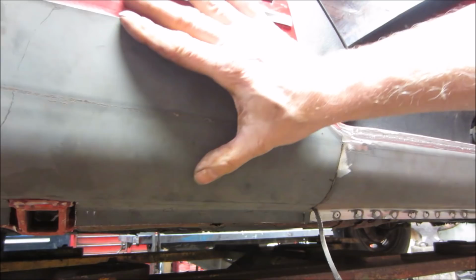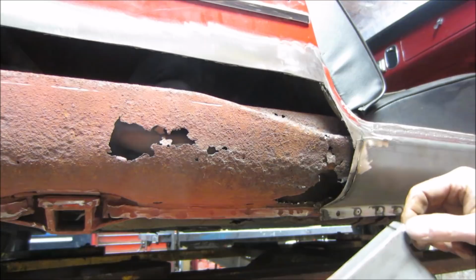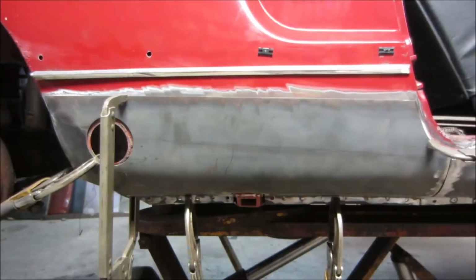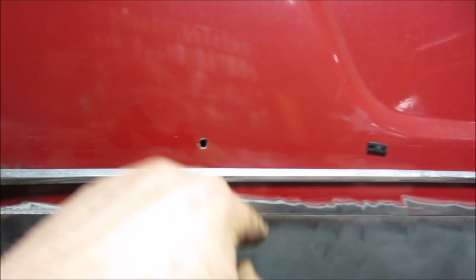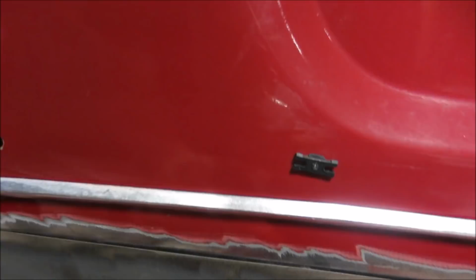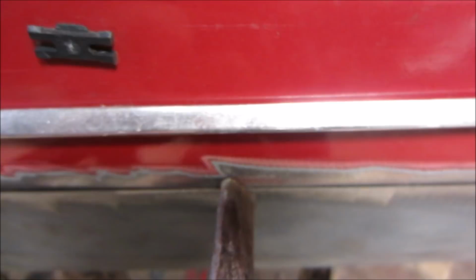I think we did. All right, finish trimming both of those off. And that should do it for us. It's fit up about as much as I'm going to be able to do. Butt joint there. And a butt joint there. And the rest is going to be a lap going across. And I'm going to use the feel of the hammer when I'm tacking to close that gap up. Get a tack. To kind of do the same going down the line.